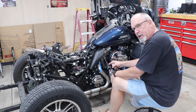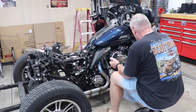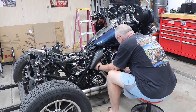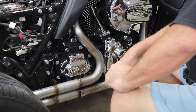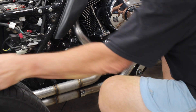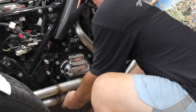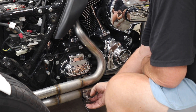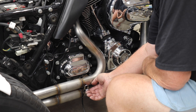The next step is to put the pipes up into the cylinder heads and secure them — start with the rear one first. Got them in but they're not in the slot yet, so there's some finagling to get them up into the slots. Finally got the pipes on — kind of a pain, but we're on. Next we install the bracket that clamps around the pipe; it's open wide so you can get it over the pipe, then close it down with clamps and channel locks.